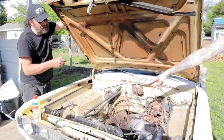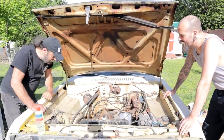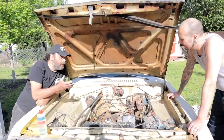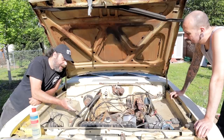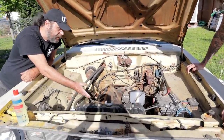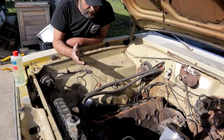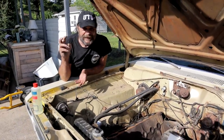Which two? We only tested one and two — no compression at all. I don't know, like I said, I don't know if it was out of time... Well, timing wouldn't affect compression. It could have been a head gasket, it could be bad rings, it could be anything. So what we're going to do is give this motor a cool leak test.